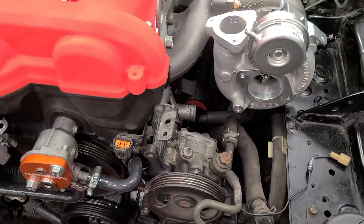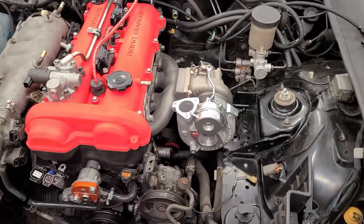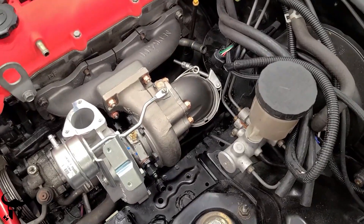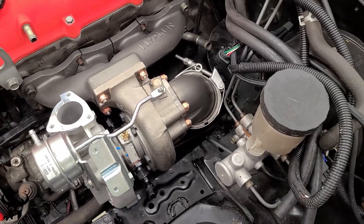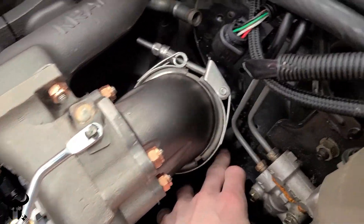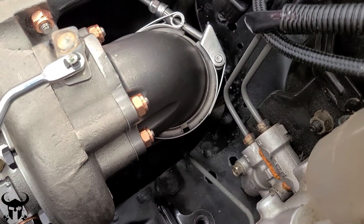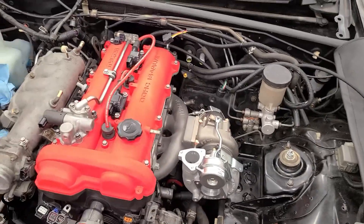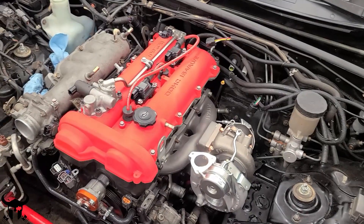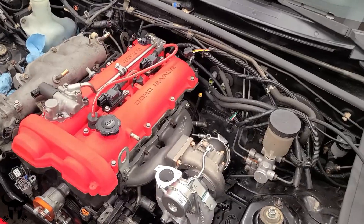Now I actually have vertical adjustment. When those were flipped around the adjustment ended up looking more horizontal than vertical. The turbo is just sitting in here. Getting these V-band connectors made up was very difficult for this downpipe, and then I also had to hack away some of the inside sheet metal right here and I used a Dremel to do that. I didn't show a lot of the clutch installation when I had the engine out, because if the motor is out of the car the clutch installation is really straightforward. I just used the Happy Meal from Flying Miata.